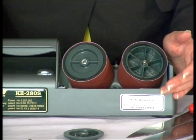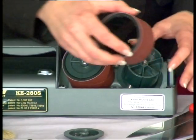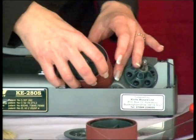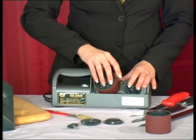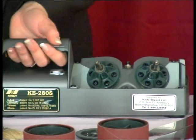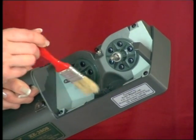Never use any liquid to clean the machine. To gain full access, slide off the axle drums as well as the carrier wheels, and brush over a suitable receptacle, i.e. a rubbish bin.